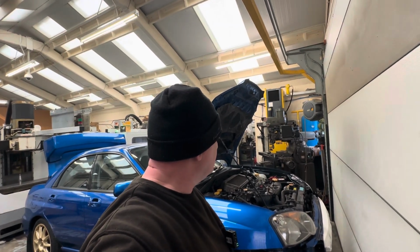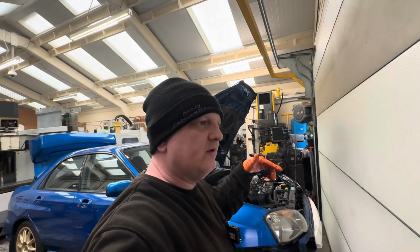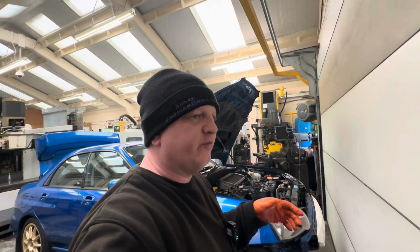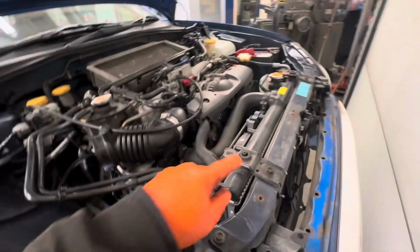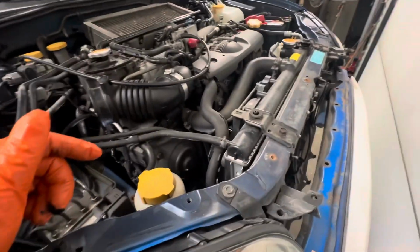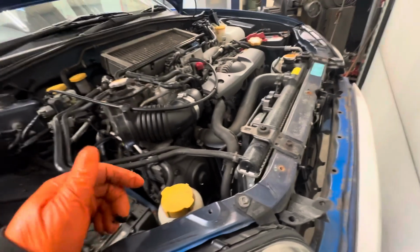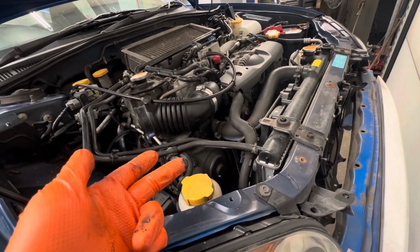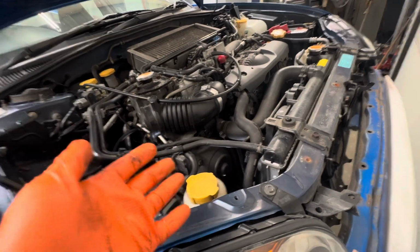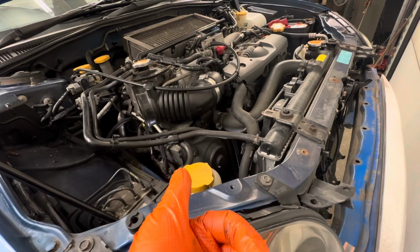And then obviously, once that's done, I'll then drop the oil modine off, which means dropping the coolant. And if I was dropping the coolant, I wanted to take the radiator out to give myself access to the cam belt. So one job pretty much leads into another, but we definitely wanted to do cam belt, coolant flush, oil and filter change, air filter, spark plugs and rocker cover gaskets.